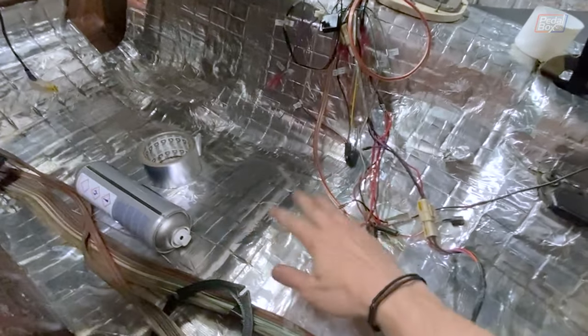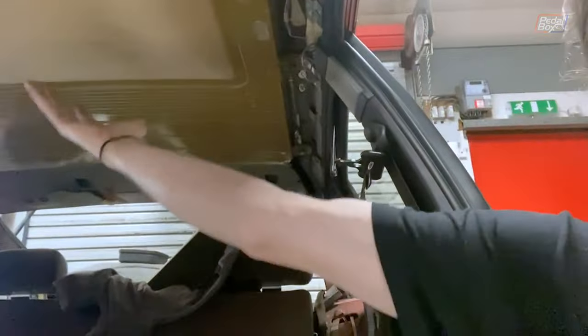That's a slightly unfair comparison since the floor is always more rigid than the door panels, but you can hear the type of improvement you get. The roof has had a full treatment on the whole inside, most of which you can't see because the sunroof sled is now in place — but that made a huge difference. When you tap the roof now, it's quieter than the roof of a modern car. The comparison I use is a 2008 BMW 5 Series, which sounds really solid — but my roof sounds more solid: a flatter, more dead impact, more of a thud and less of a ringing, which means a lot less noise is going to make it through into the cabin.